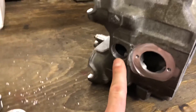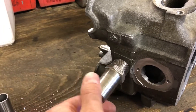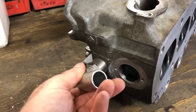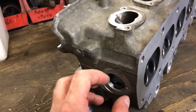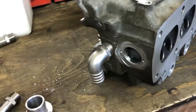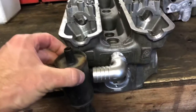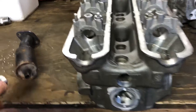On this end, I've taken the core plug out. Some people have a piece welded on here, but I decided to pop the core plug out and I found a nice stainless steel screw fitting. I can't decide whether to run the straight one or the 90-degree angle — it would be a bit of a pig fitting once it's all in place, but this is removable. A lot of people have this welded on as hose tails; I wanted to go with physical retention because I just prefer it. This breather — if the head is sitting on the car like this — I can have the pipe coming back this way and into the breather on the clutch case. Whether it's the 90-degree or the straight fitting, I haven't decided.